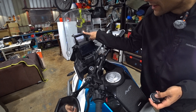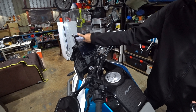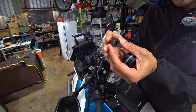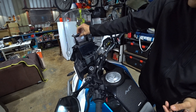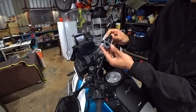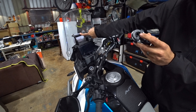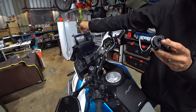You'll notice I've put an adapter on my 12mm bar to increase the thickness to 22mm. This part is not a stock feature or something that comes with the navigation unit. It's a hollow tube — this is actually a first prototype I made, just an inch long — and it slides on top of the metal bar. The bracket that comes with the unit has some padding in it, but it's too small to mount on the 12mm bar that is stock on the CFMoto 450, so you'll need to make an adapter or get one to install on there.